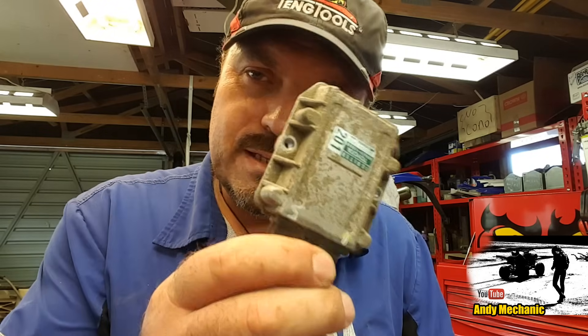I'm right in the thick of doing some tests on a 1992 Toyota MR2 and it's got an intermittent fault where the car basically grinds to a halt — it stops as if you've turned the ignition off — and a warning light comes on the dash showing code 14, the flash code of 14. One of the components that can fail indicated by that code is the igniter.